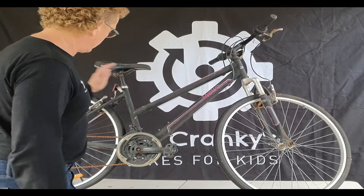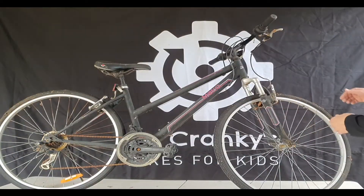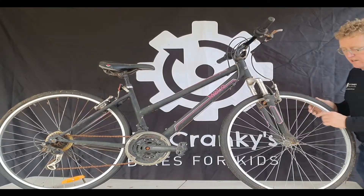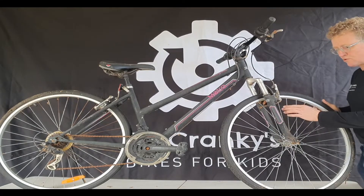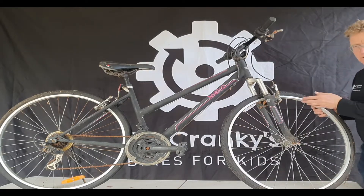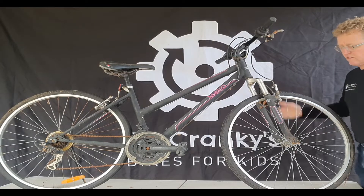The next major item is the wheels and tyres. Just pick the bike up and rotate the wheel — see if it spins freely and if it wobbles side to side, and check for any broken spokes. One broken spoke is fixable; two probably means something else is going on, though it can still be fixed. If the rim is really rusty it might not be worth keeping, but it'll still run for a while.